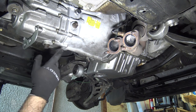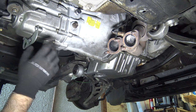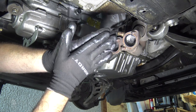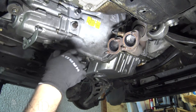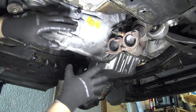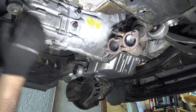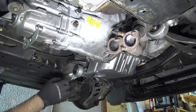That's why you want to make sure it's in gear, by the way. Just shove your gear selector all the way forward. That way when you rotate the output shaft, the input shaft also turns, and then it slots into the correct position in the clutch disc. Remember, that clutch disc is being sandwiched by the pressure plate so it can't move — you're going to have to rotate in order to slide into it. Once you're slid in and several things are engaged together, the transmission doesn't really want to fall down. So it's safe at that point to remove the jack and then get under it and just wiggle it around to get it slipped on.